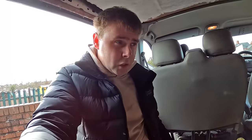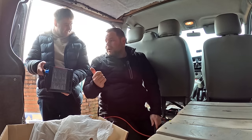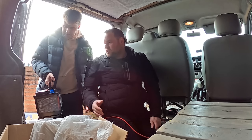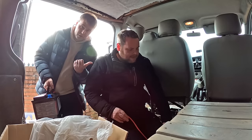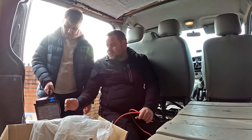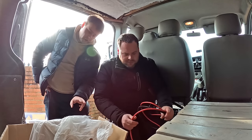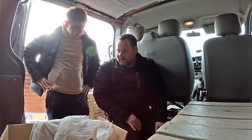They've also sent me a Victron DC to DC charger. I'll go into more depth about the Titan battery as we film. It's about half the weight of the two lead acids - there's sod all weight to it. Dave already has the same battery. This standalone battery is equivalent to three 142Ah lead-acid batteries, and because lithium can be run down to zero - whereas lead acid you can't go below 50% without damage - this one battery alone is the equivalent of 410Ah of lead acids.